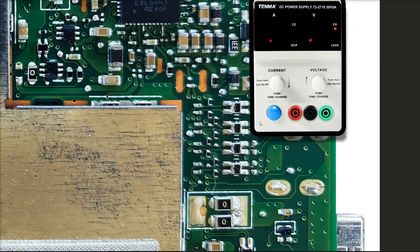Now because I've seen some damage — or what looks like damage — on the board, I'm going to be a little bit conservative when injecting the voltage. We know the power adapter for this is 5 volts and 2 amps, however I'm going to limit that to 500 milliamps just in case there is a short on the motherboard. I'm going to connect the black wire to ground on the outside, and a red jumper wire to the point where the two zero-ohm resistors are. On the voltage, we'll set 5 volts with a current limit of 0.5 amps, or 500 milliamps.